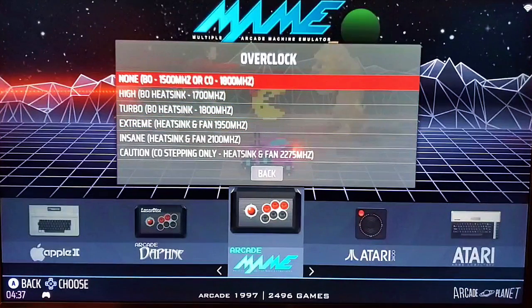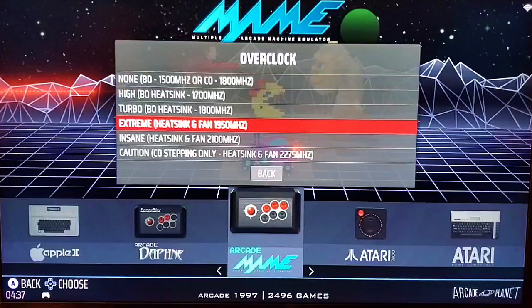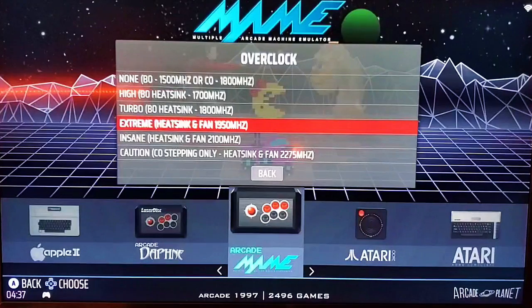None is the standard clock setting for a Pi. The one I personally use is 1950 megahertz, which clocks your GPU at 700 megahertz. I find it's the most stable. If you're using a Pi 400, you can set it at this and not worry about it — the Pi 400 has great passive cooling. If you're using a Raspberry Pi 4 or 4B in a case, make sure you've got a good heat sink and a good fan on it.